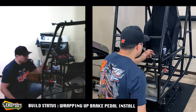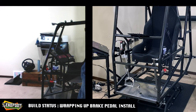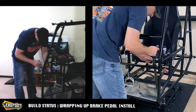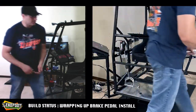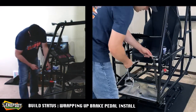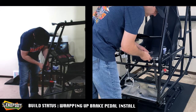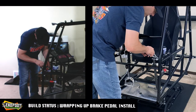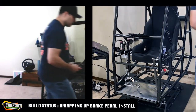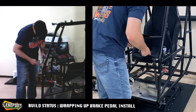So I want to lock down our lock nuts. We'll need our 7/16 wrenches for that. And one lock nut is going to, oh, I guess we were good with our half inch. I stand corrected. That's pretty convenient. So one lock nut is going to lock the heim in place. But I do need channel locks here to hold the heim joint while I tighten the lock nut.